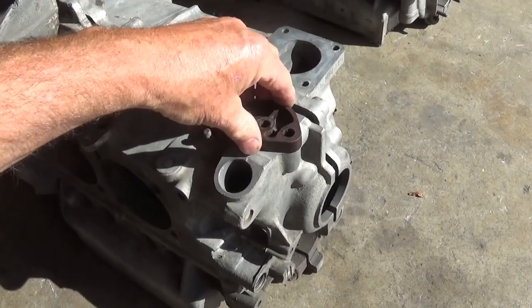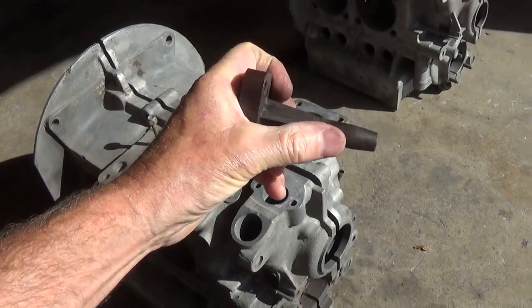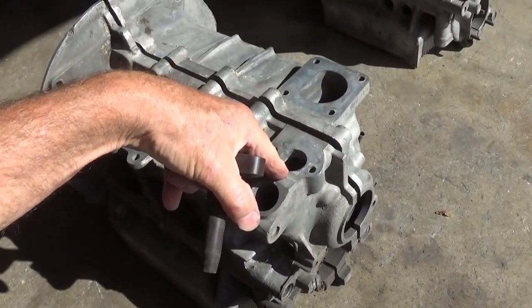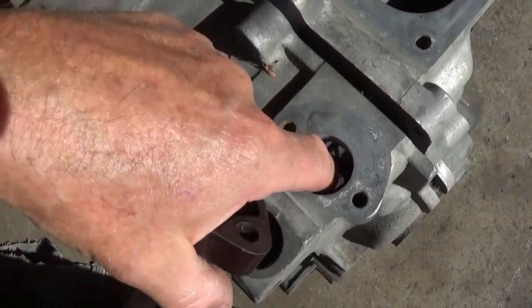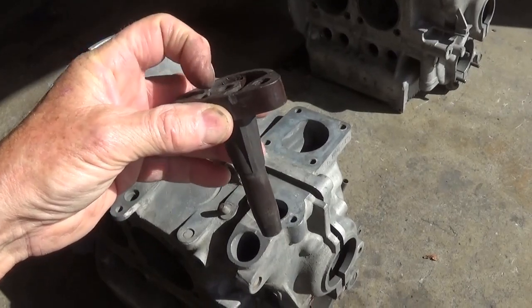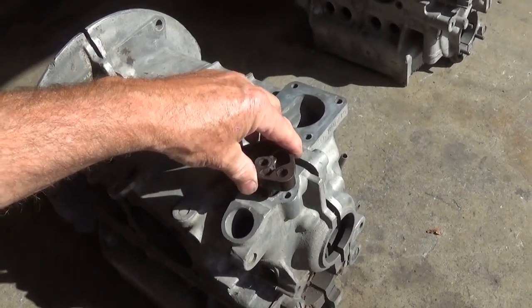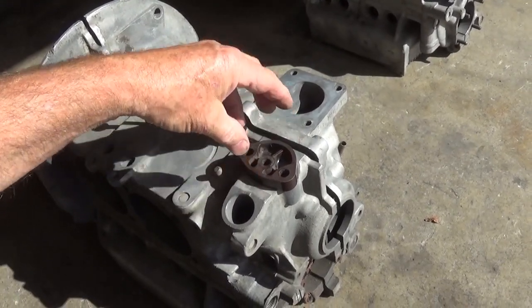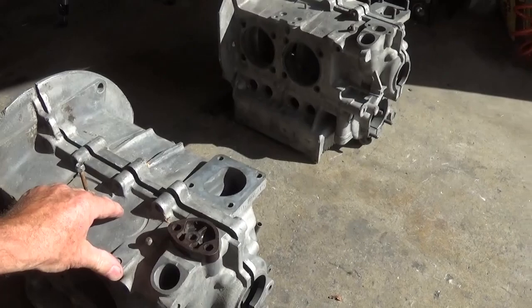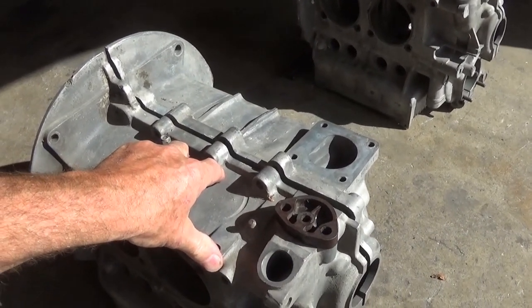— if it's sticky tight in there, this could be the cause. I've heard of this happening: the phenolic spacer — the metal of the block is expanding on that ring down here, and it's pinching the fuel rod, stopping the fuel rod from going up and down. You wouldn't think that would happen, but I know several cases where this solution was the answer and it stopped it.